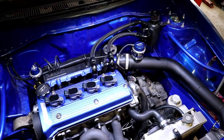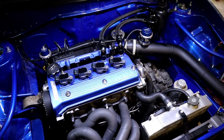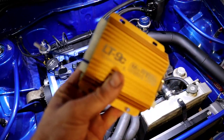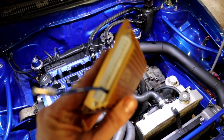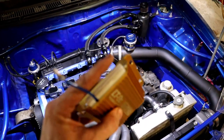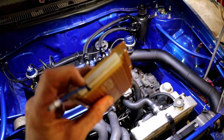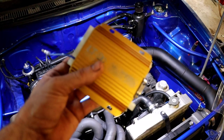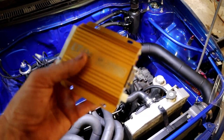The reason I've upgraded to the Haltech is it has a lot more inputs and outputs for sensors. The Microtech is more than capable for a lot of standard applications and basic turbo stuff — it has four ignition outputs, four injector outputs, TPS, water temp, air temp, two auxiliary inputs, three auxiliary outputs, and it's a great little ECU at around $800.